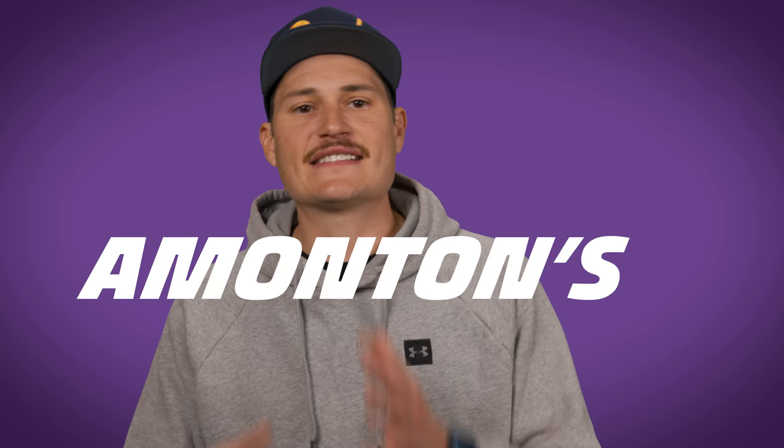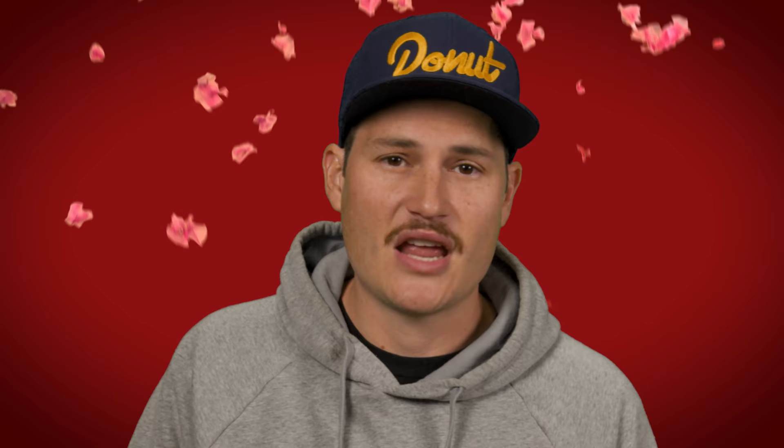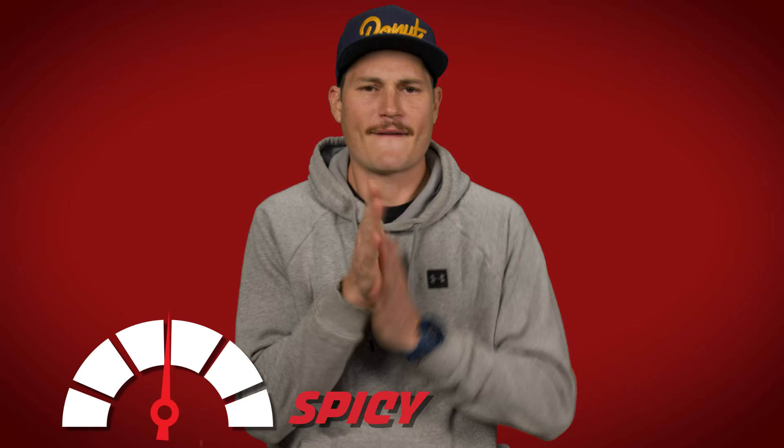The amount of friction is determined by the materials the two surfaces are made of. Any two materials have a specific coefficient of friction, a number usually represented by the Greek letter mu — it's a U with a little tail. That's why brake pads are sometimes described in terms of their mu factor or mu level. The higher that number, the more friction they produce. But the total amount of friction also depends on how much force is pressing the surfaces together — that's Amontons' first law: the force of friction is directly proportional to the applied load. The muscle in your brakes depends on hydraulic pressure.